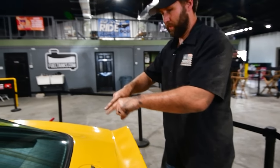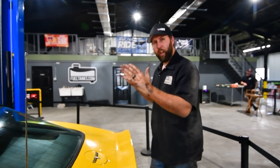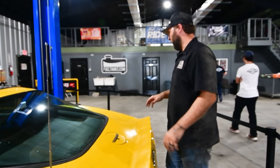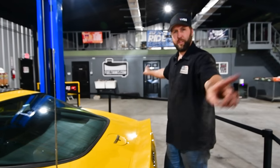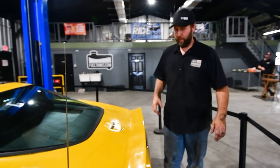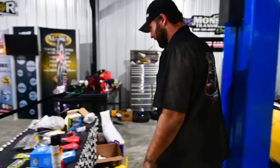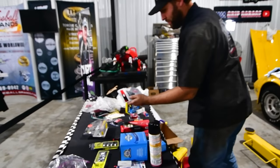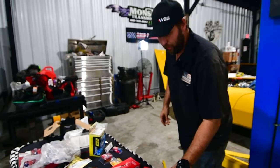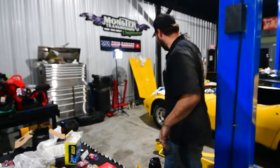Exhaust comes out and then down on the mufflers, I'm gonna cut it to where the pipes are facing out right towards the tire. So if we get any smoke, that exhaust should just blow it right out. But then we'll have to fab up some sort of bracket. But I got all these miscellaneous hangers, and I call this plumber's tape, zip ties, whatever we need. We'll make it happen. I'm gonna get the Sawzall and just zing zang that off.